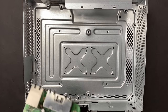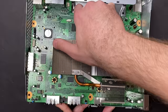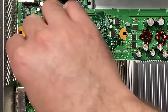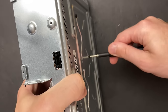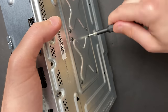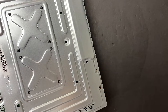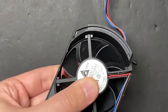Some people test the console at this point, but there are still eight screws that fasten the two heat sinks to the bottom of the case — not to mention the fan and the housing that draws air away from the heat sinks. I don't like to cut corners. I'm going to properly assemble all the cooling apparatus before I turn the unit on and test it. Anytime you're installing a heat sink, it's always good practice to crisscross tighten the screws so the thermal compound is distributed evenly and there are no weird pressure points on the chip. If your fans are dirty, make sure you give them a good cleaning before you reattach them.